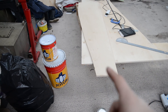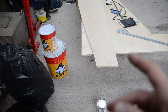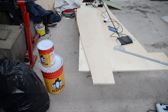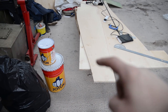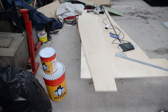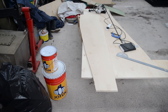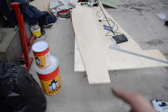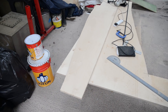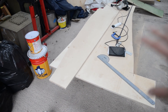That's the starboard side, so it should be very similar on the port side. What I'm going to do now is paint this just to seal it. When I get down to the boat, I'm going to have to cut the slots for the ribs and probably jog a little bit more just to get it in right. But this will never be visible, so it's not a huge deal as long as it doesn't touch the hull. I'm going to paint it now, and when I do cut out the slots, I'll paint those slots then later. I just want to get all of this sealed as quick as I can.